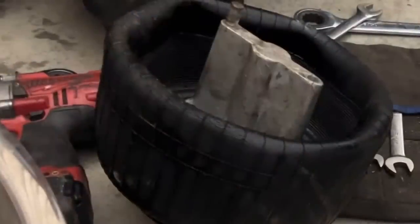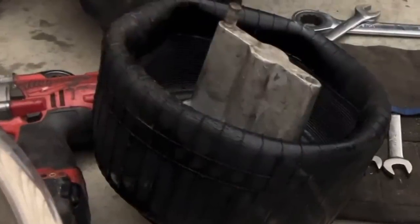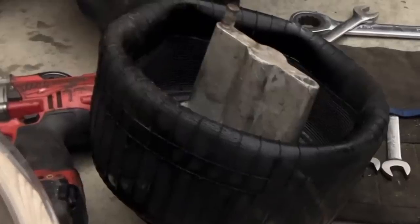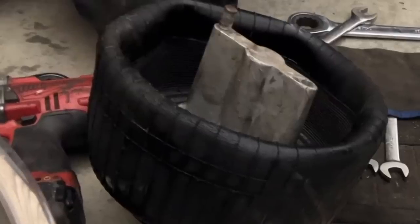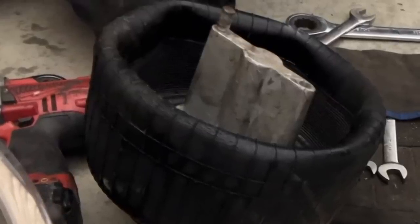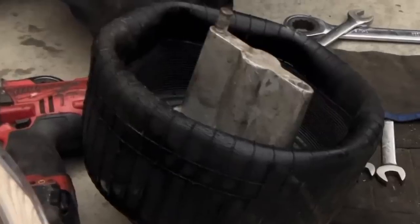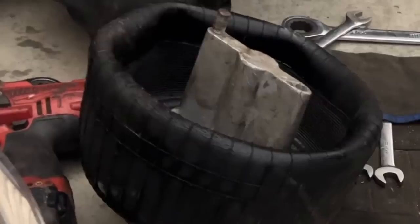So we went to air the bus up to pull it out of the shop, and this airbag had totally fallen apart. There were no nuts on the bottom of it, and the stud had come out of one side and allowed it to get kind of cocked in there sideways, and it took the seal of the airbag out, so the airbag couldn't air up. So we had to take it all apart, and we were able to reassemble it, and the mount base plate for it was cracked, so he took it to an aluminum welder, and we had to weld it up, put new studs in it. And we were able to remount the airbag back on there.